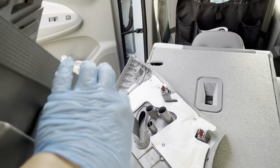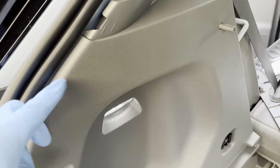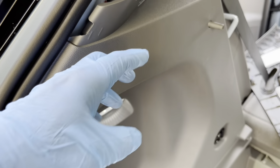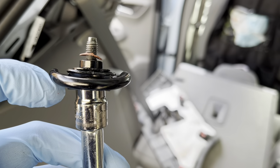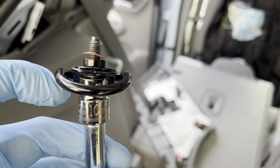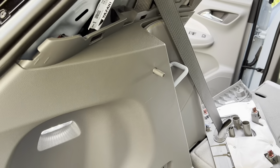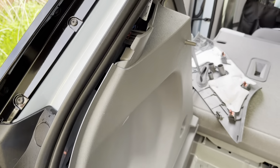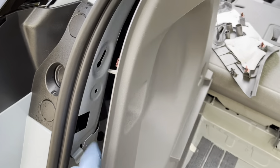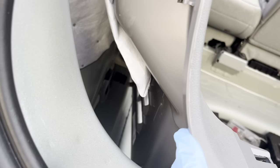Then you can take this piece out. As you can see there are only four clips, so once you take it out just slide it along the seat belt and put it with the reclined backseat. Now for this one — it has many pins and it's pretty tight so I don't think you can remove the entire thing. You'll need to loosen a ten millimeter screw. It's not gonna take too much force. Once it's out, start pulling along the side to loosen up this side panel. You won't be able to remove it completely but it should give you enough room to access the connector.